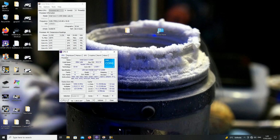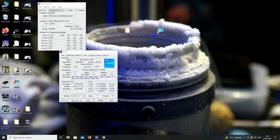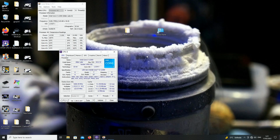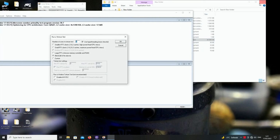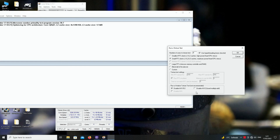But now I just want to show you the issue for daily performance that I experienced or faced. So let's close that one and let's go to Elite X1, and I will downclock a little bit because I want to demonstrate this for you guys. So we'll go back to 35, 1.20, like let's put 1.24 and Vcore down to like 1.28 because we don't want to crash. So roughly 5.2. Okay, and let's open up Prime95. I just want to show this to you guys. So small FFT and AVX1.